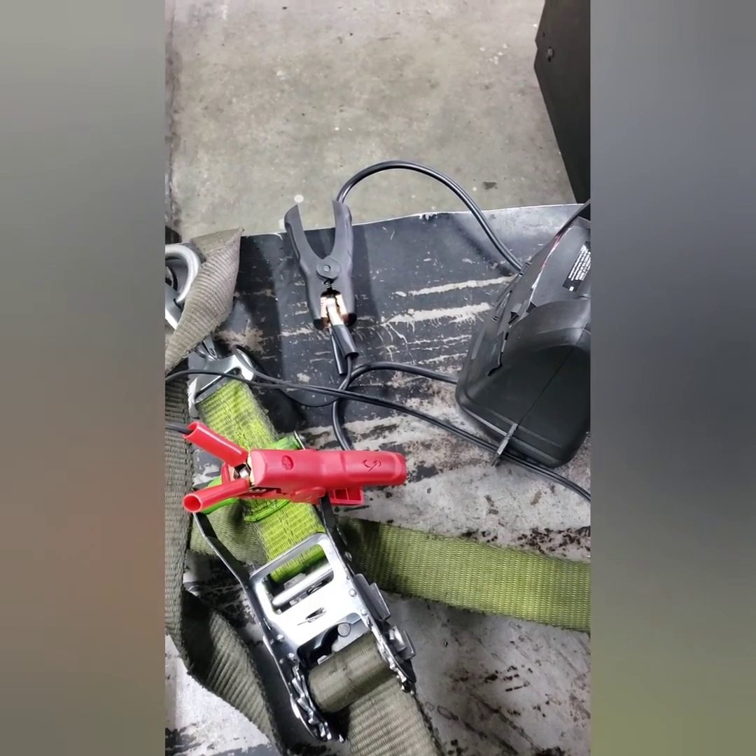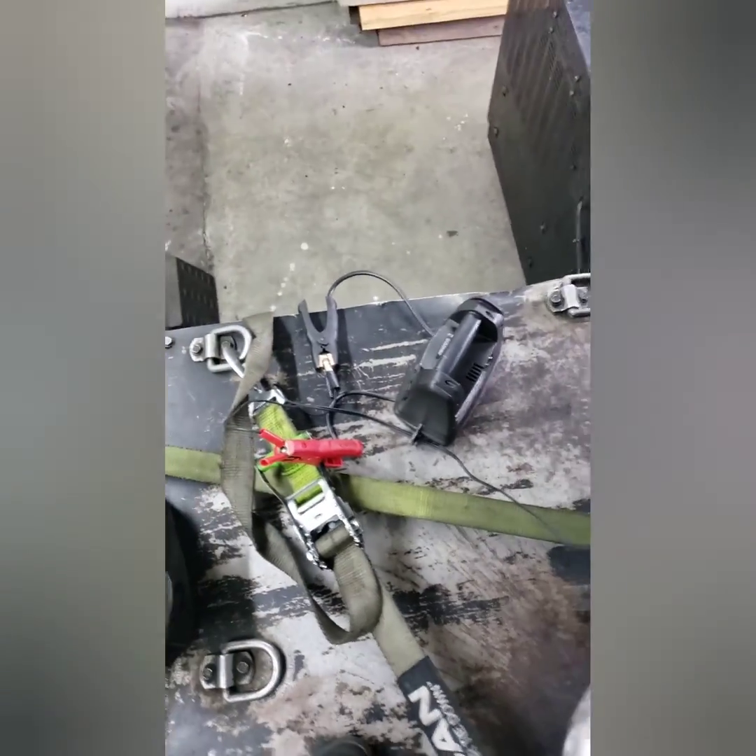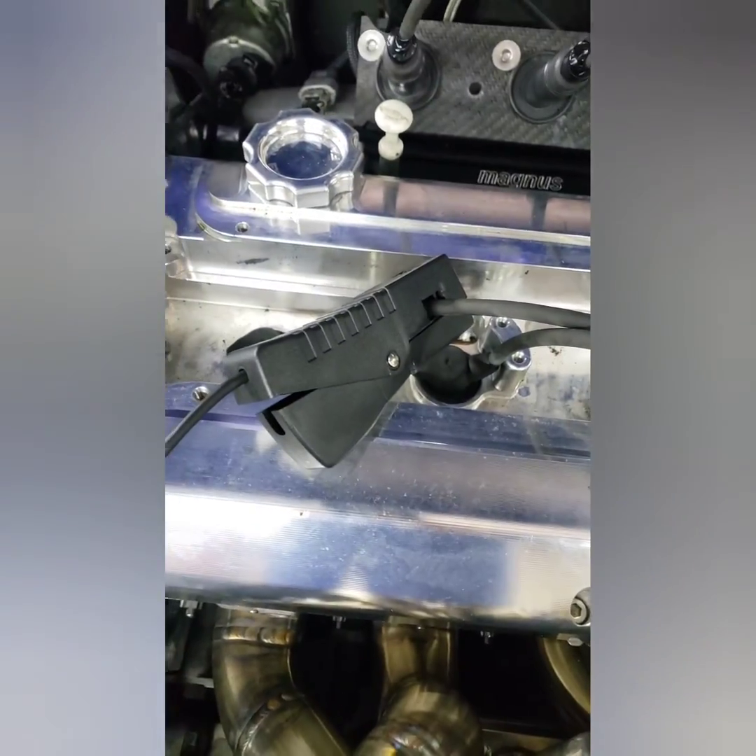For sake of discussion, this is what I was talking about with the jump pack — that's gonna be my 12-volt power source. And then obviously that goes to number one. If you look down in there you can kind of see a white dot, it's bouncing around just a little bit. This is with the timing lock at zero; it's moving one or two degrees even though it's locked, so I'll probably pull one out just to be safe.